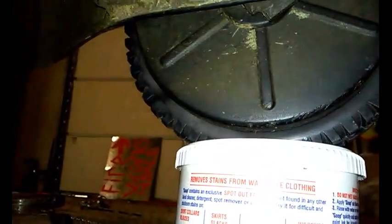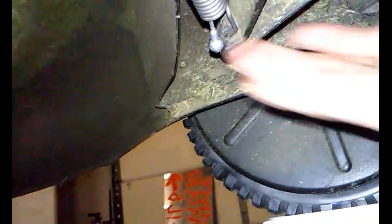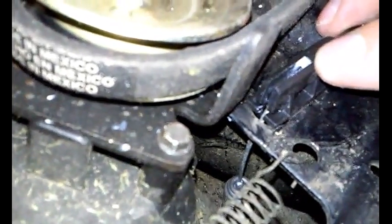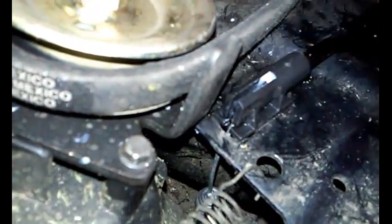And once that's done, I just got to put a little tension on the cable and it'll pull it tight and it won't come out again. Okay, here it is, in that small hole there. If you see my previous video, I had to replace the wheels too. Okay, that's all done. And actually, if you look inside there, I'm not the one who did this. They actually pre-greased it in there to help it so it won't snap. But it goes the right way instead of going here. That's now set.